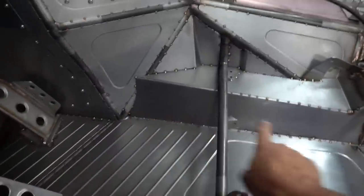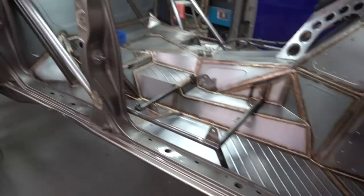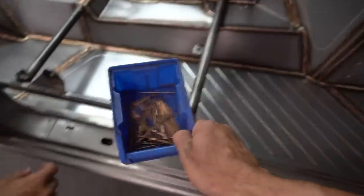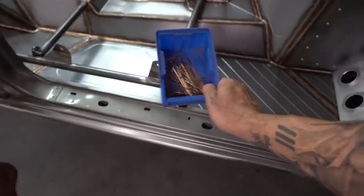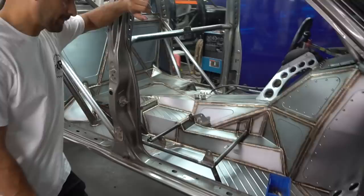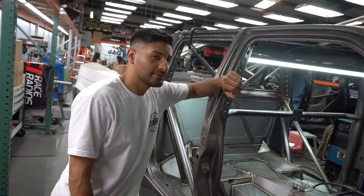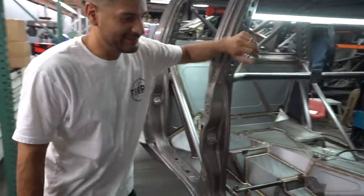Everything has to be tight, away from the seats, favoring different areas. Just getting that tunnel in for the exhaust — everything's sealed now. That's done on both sides and I've got about three quarters of this thing welded. I've been saving the TIG rods specifically from the inside of the truck; each one is a three-footer. I estimated 20 hours but it's actually like 40 hours because I've already put 20 in easy.